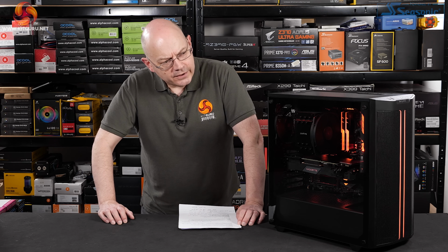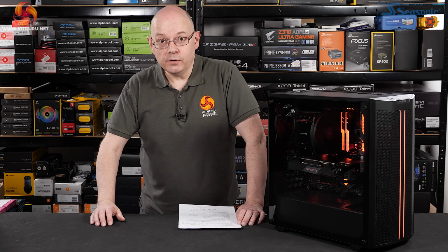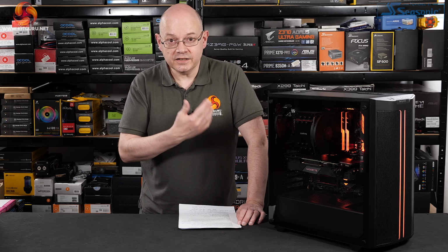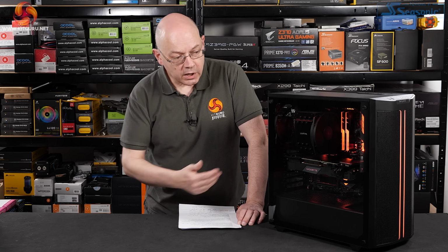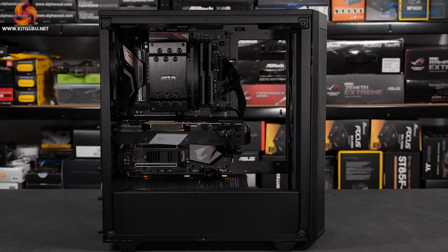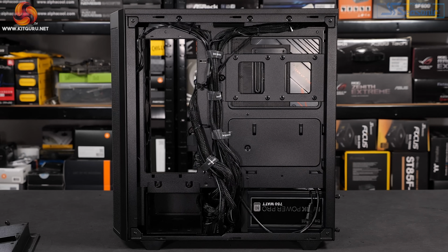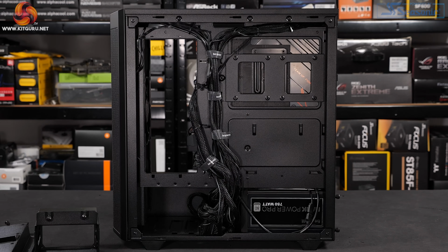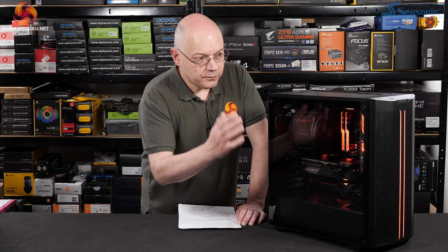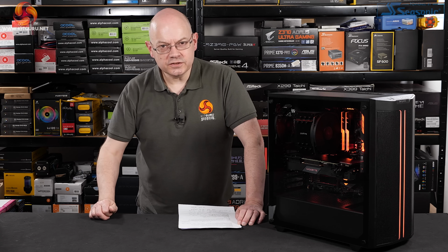What would I change about the DX? Well, the front of the case is clearly working well, no argument about that. The panel's fine, the lighting's fine, the looks, the aesthetics, the USB-C, all that, terrific. When you move slightly further back, the SSD mount is a bit of a pain because I'm not using it, but if I remove it, I have a great big hole in the back panel of the case. Similarly, the drive caddy down the bottom there at the front, if I pull that out to give myself some more cable management space, I've got a hole in the power supply shroud. They haven't really thought that through to my mind. So the front's fine, but move back a few inches, not so great.